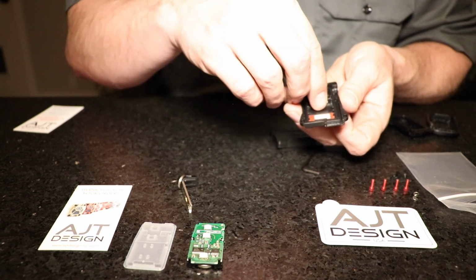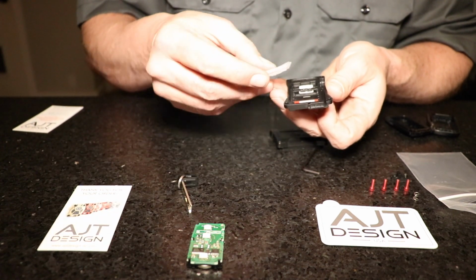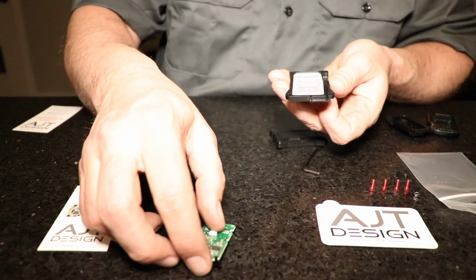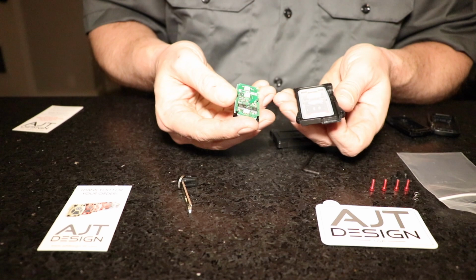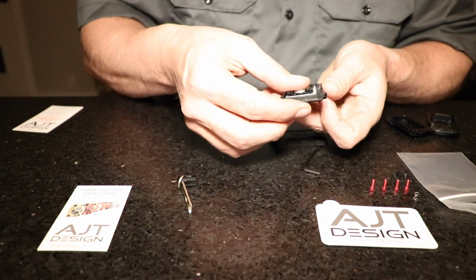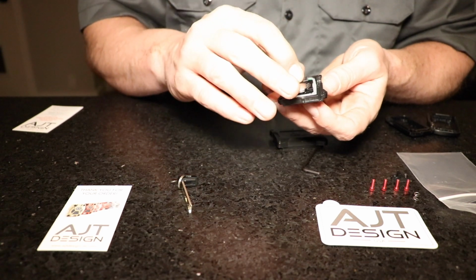On the Tacoma key fob, you can take a look, and you'll see that the lock, unlock, and panic buttons go in that order. You can always flip it over and check out where you are, or even better, grab your spare key and you can look and see what order they are in. Make sure when you put the board back on that there's the two buttons on the top and one button on the bottom, or the battery facing the bottom in this case.